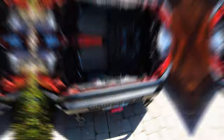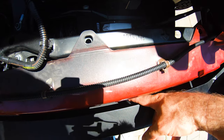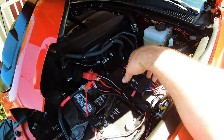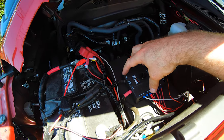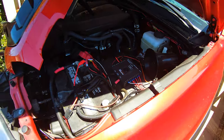Now for a little bit of easy wiring. Because I do run an S-Pod, all I got to do is run a positive and negative to the S-Pod and take up a switch spot. Other than that, it's pretty basic. You can see the little wire right there coming off the light, which I'm going to zip-tie down in a second, running it through here, all the way to my S-Pod. The S-Pod uses its own safety mechanisms with fuses, relays, everything it needs to make sure that everything that's part of the S-Pod is safe to run, and it gets its power directly from the battery.